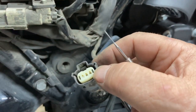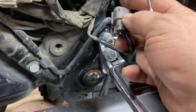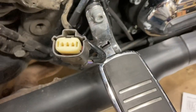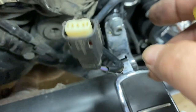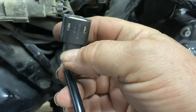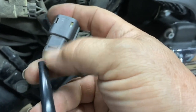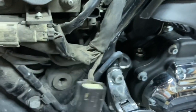To get it out, you take a small screwdriver and pop this out just a little bit to disengage, then go through this little hole right here with a pair of needle-nose to pull out when you release it. As you can see from the top, I took a small screwdriver, put it here, popped it out just a little bit. Now I'm going from the top with a small jeweler's screwdriver to release the pin. Push it in and push the pin out — that clears the way for the wire. The wire just pushes in there, you'll hear it click, and you press this down and it locks in. This red wire is the one going to the battery — it gives you the ability to have power to your accessories and goes to the battery for constant fused power.